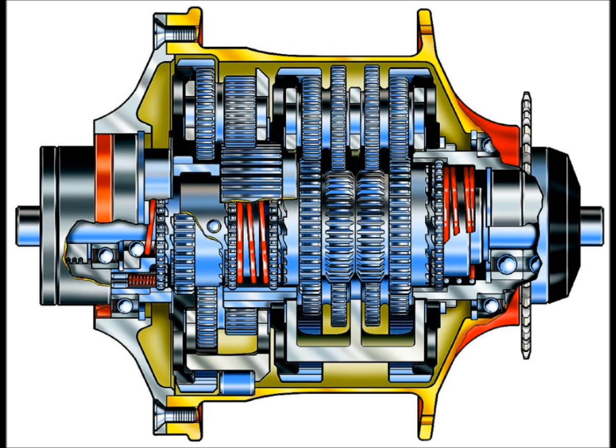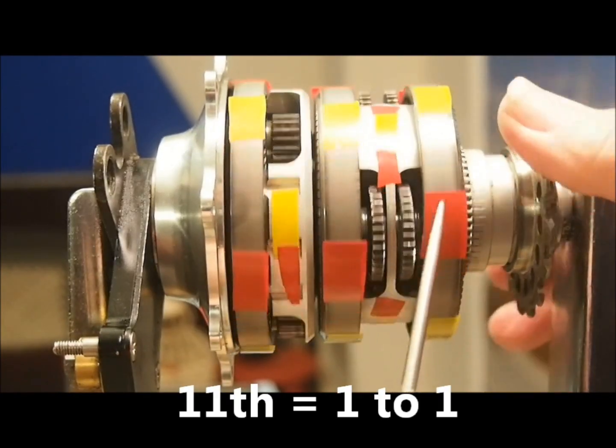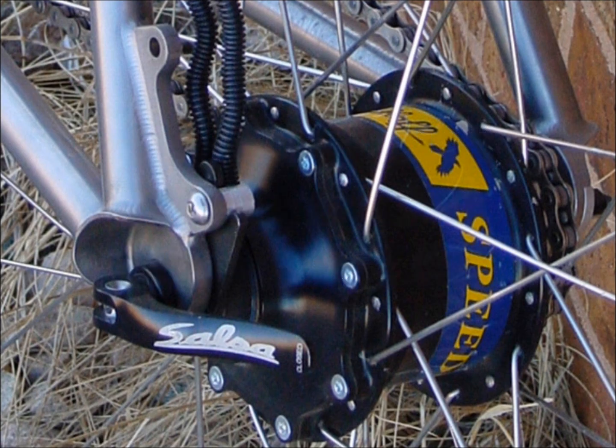The overall ratios in high range are as follows: 8th gear 1 to 0.682, 9th 1 to 0.774, 10th 1 to 0.881. 11th gear is a repeat of 4th gear with direct coupling through the primary and secondary stages — 11th is a direct 1 to 1 ratio from input to output. 12th gear is 1 to 1.135, 13th 1 to 1.292, and 14th gear 1 to 1.467.